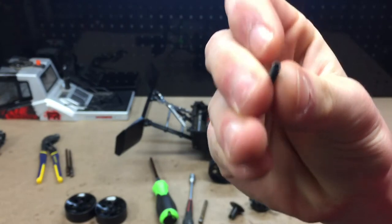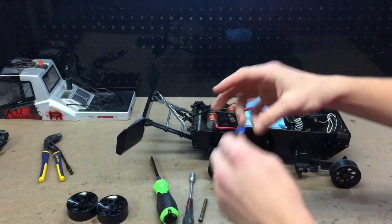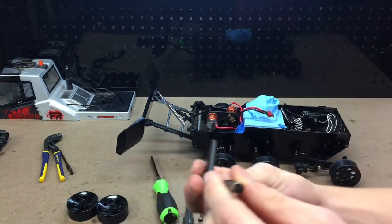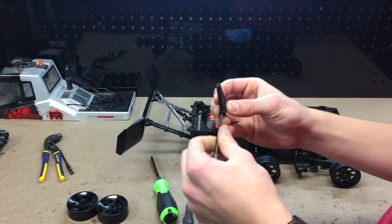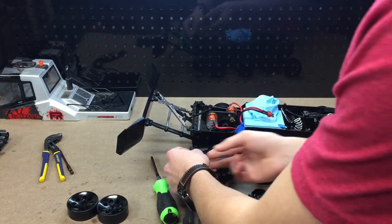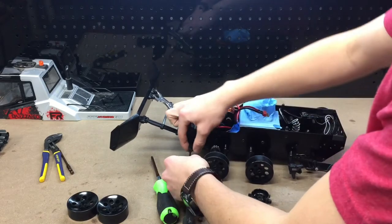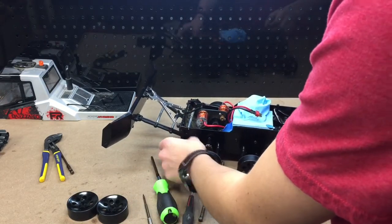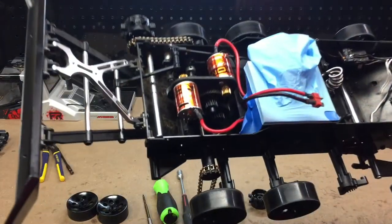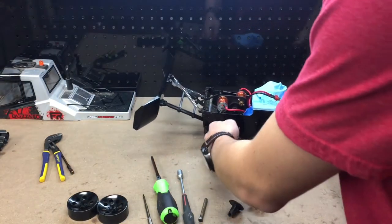What we're going to do is make sure that the Allen screw is facing the outside of the machine, simply so that when you have to adjust these again, all you'll have to do is remove that screw. Then you can put in your 1.5mm Allen wrench and back that off a little bit. I like to set it on here leaving a gap between the machine and this piece — that's about the gap I like right there, so you can see light through it. It'll come into play a little later on.